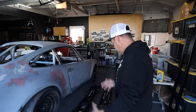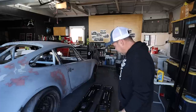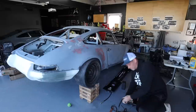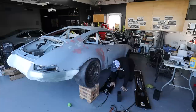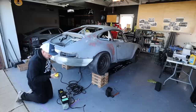My current question is which direction I should orient this. I'm thinking I might reverse it so that the arms go up this way and the car goes toward the back. Maybe I'll just shove them underneath and see what happens. I think every corner is going to have a small block and a big block underneath. I got these to sit on the seams because ideally if you can jack it up on a seam, that's a good thing. These things have a little ball bearing that locates a notch — you've got to make sure the notch is located with the ball bearing, and then you are good to go. Super easy to connect once you've got it dialed. I'll raise it a little and see what happens.